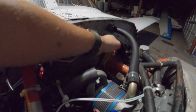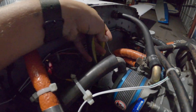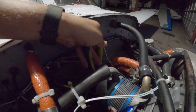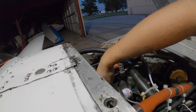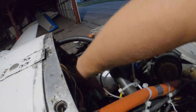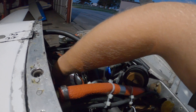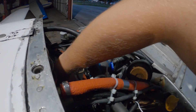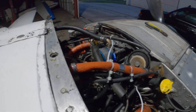These are usually going to be kind of a pain — it'll be a little bit tight the first round or so just because everything's still warm. Definitely make sure to take care when you're working around these cylinders because these are probably still a couple hundred degrees and you don't want to touch even the shroud around them. Alright, so now I got it loose enough. Just watch the lock wire so you don't cut yourself, but I got it loose enough where I can just spin it off by hand. Fortunately these are positioned sideways so it's not going to get you full of oil. That was actually a pretty clean pull, so I'll just tip it up and set it down on the lid.